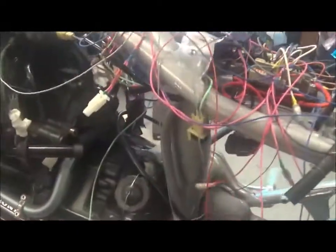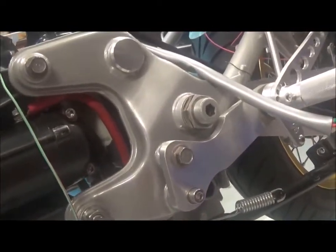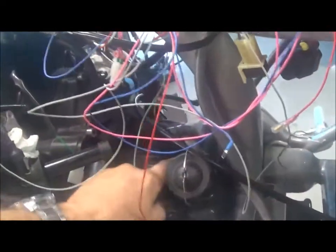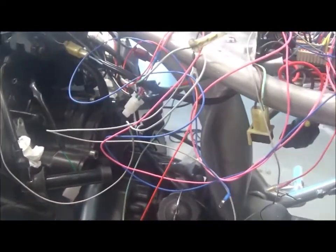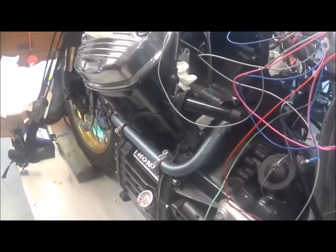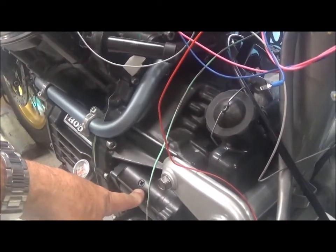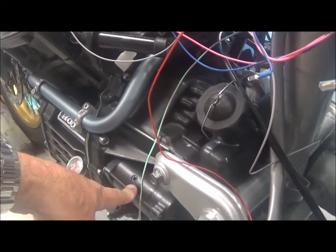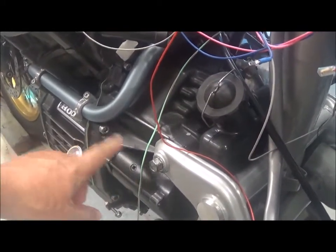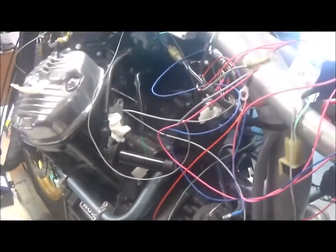Excuse the cables — there's the water bottle, and I just left a little bit of white there so you can see what the level is. The Pulsar cover has a new gasket and I've replaced that and remounted the engine. Just a little note: I had a bit of trouble getting it lined up with the starter motor in place, and then I realized that when I first put it on the bike was pretty bare and I didn't have a starter motor on. I removed it and it went on quite easily, so back on track.